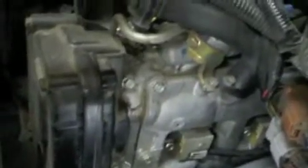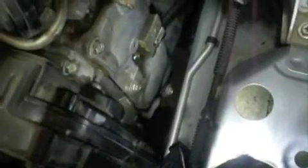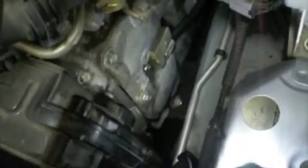So you're going to need obviously some sort of setup just to be able to deal with that. Here's how big my hand is in there. You have no room to work. So you basically gotta get your spark plug in there and maybe get the swivel attached to the socket. Then stuff that whole thing in there and start building off of that. It's kind of like Tetris. You just gotta figure out the right order. So you get your extensions out to however far you're comfortable working with. Take that one loose.